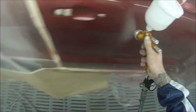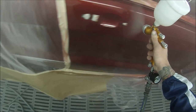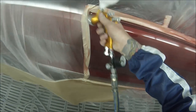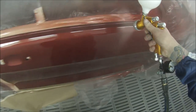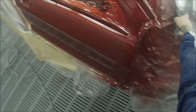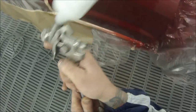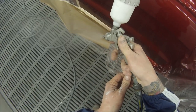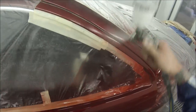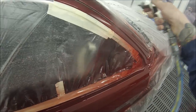We gave a good five minutes in between coats. If you don't wait long enough in between coats you can end up getting paint runs, solvent boil, and many different problems. Temperature is obviously going to determine how long you have to wait in between coats, and ambient temperature, plus the hardeners, reducer, clear and products you're using are also going to factor into your drying times.